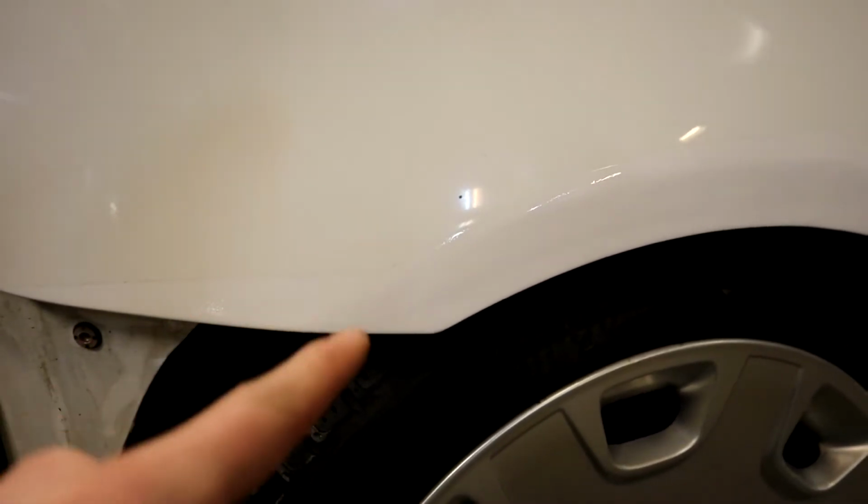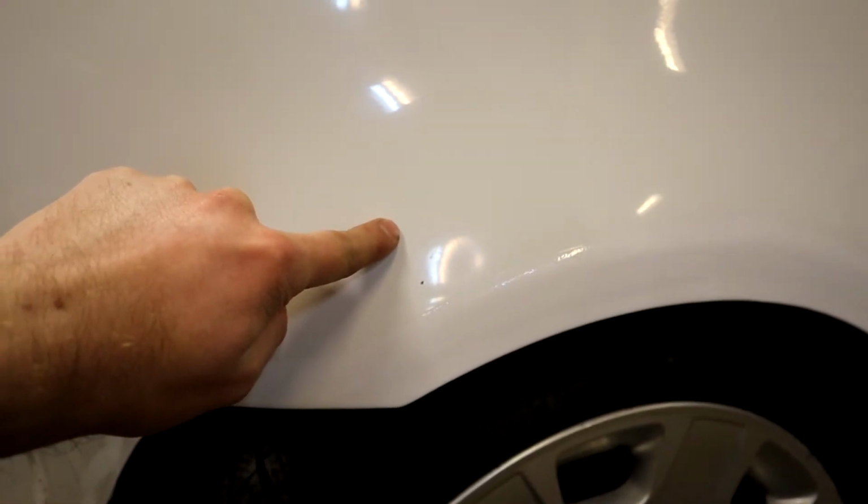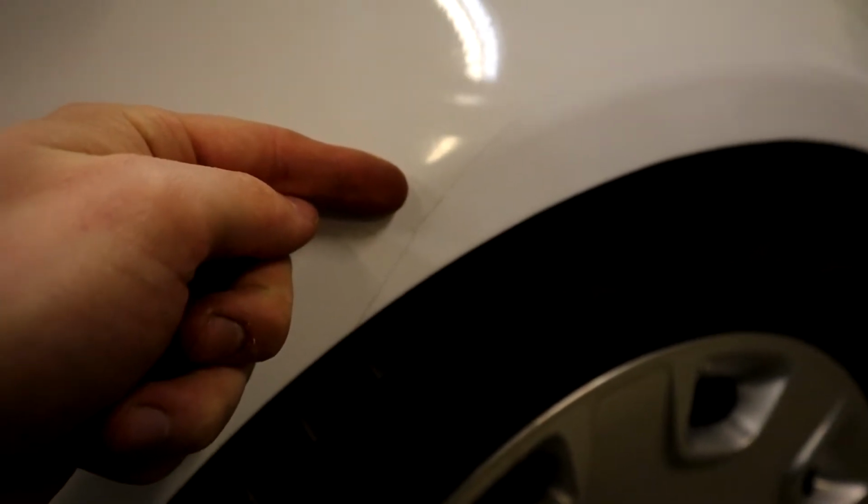It has not fully hardened yet, but well, yeah, and we do need to polish this car pretty bad, so hopefully we can polish this so it's the same color, because the original color is pretty dirty. So it's like Mr. Adam said, it's dirt from the tape, so hopefully that stupid mark or line will get rid of. And it's a little bit of orange peel, but hopefully we can wet sand that away. But no, it just needs to be hardened.